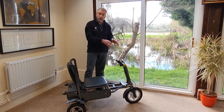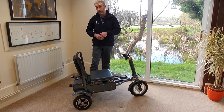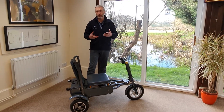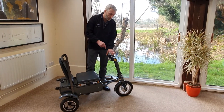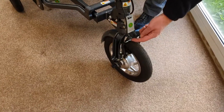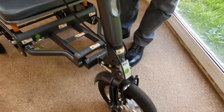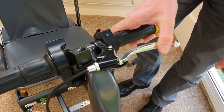There's no reason to lubricate the front wheel because it has the integral electric motor in it, so it shouldn't be lubricated. The rear wheels have high-quality bearings greased at point of assembly and don't need additional lubrication. The only thing you might do if you take the eFoldie out a lot in the rain or inclement conditions is put a small dab of oil at the top and bottom of the brake cable, just to make sure it stays lubricated. Apply the brakes a few times to work the oil in.